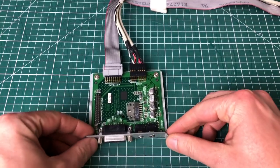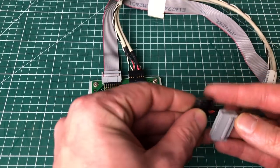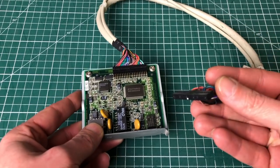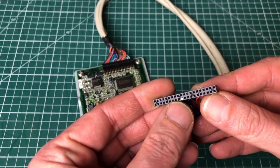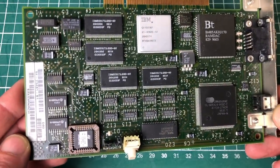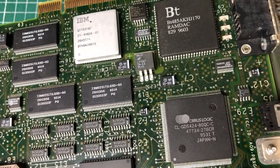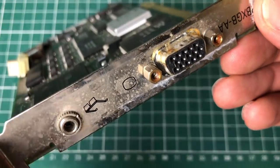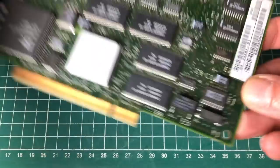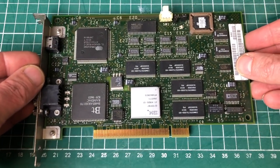Here's the sound card expansion board with speaker output, line in, and game port — two connectors to hook it up to the main board. There's a similar setup for the networking card with the Ethernet jack and a connector to hook it up to the main board; it has a cutout to ensure correct orientation. And here we have the video card, which is a special one — it contains an IBM BT chip and a Cirrus Logic chip. It has a stereoscopic cable port allowing you to hook up 3D glasses and a standard VGA connector, with two megabytes of RAM. It's a card made specifically for Digital Equipment and their Alpha series.